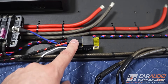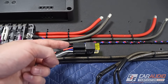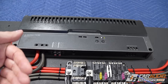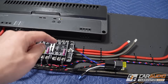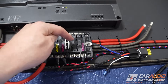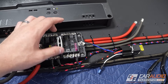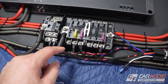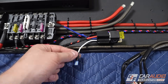In previous videos, people often say you don't need a relay if you're just doing a couple of amplifiers, and I agree — if you're just using a couple of amplifiers you can easily turn on those amplifiers with the turn-on source from your aftermarket radio or even your factory system, because the current draw on the remote turn-on circuit is very low. But that's not why I added this relay and fuse distribution block. The reason I've added these is that this allows me to add more switched circuits if I'd like — things like cooling fans or LED lights. The relay has a black ground wire, a red constant 12-volt wire, and a white wire that connects to my turn-on lead from the head unit.